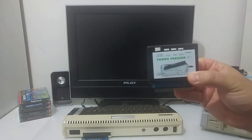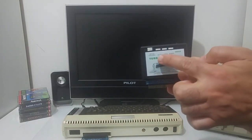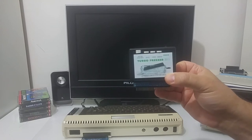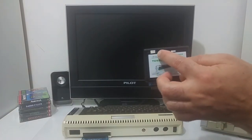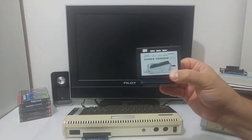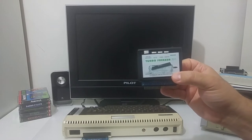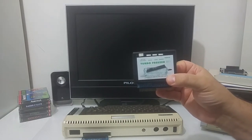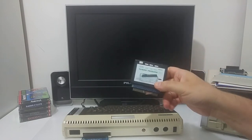The Turbo Freezer has several switches on top. The two left switches are used for cartridge emulation. The second switch is called Old OS — switching it to the right makes the Atari XL boot with the old operating system from the 400 and 800, so you can run all software without the translator tool. If I switch it to the right the Atari computer will boot to the memo pad. The third switch is called Stereo and provides support for computers with a dual Pokey stereo upgrade, so the freezer can also capture the second Pokey chip. The fourth switch is called RAM Disk.